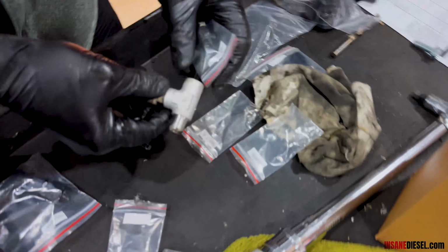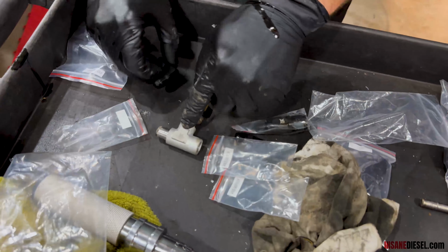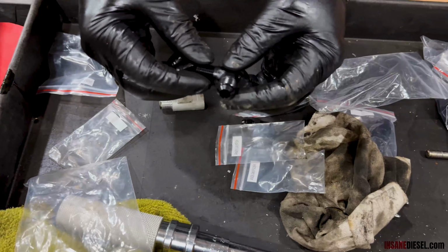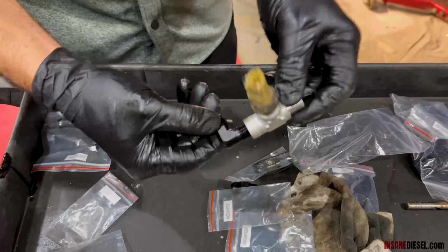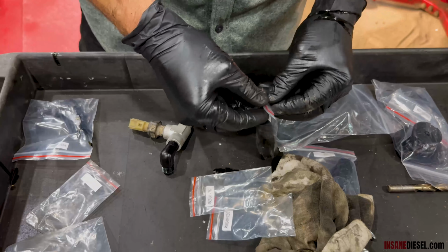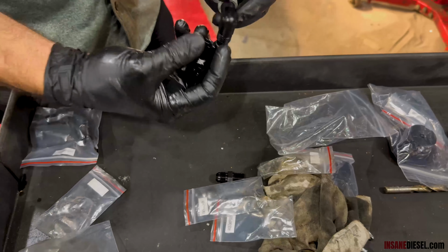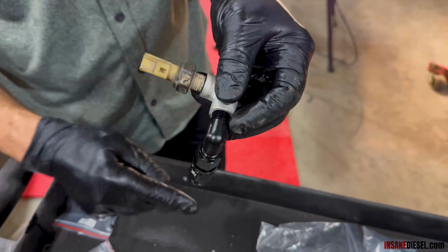So for this truck, we're going to use our TR 2025. Our oil pressure sensor is going to go in the center branch, and then we're going to use our AN 0604 MP90 here to face down. So that's basically what you're going to be putting together there. And then our hose fitting, AN 0606 FJ, is going to come right onto this piece right here and tie onto that 90. And then the hose will come out here.